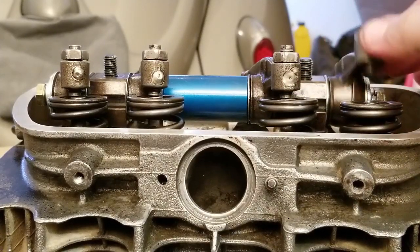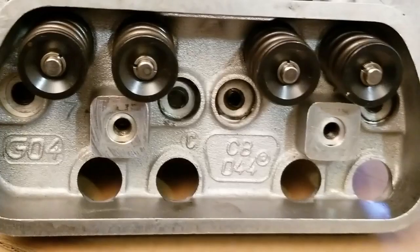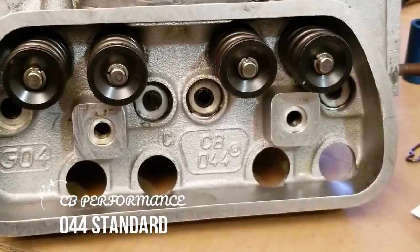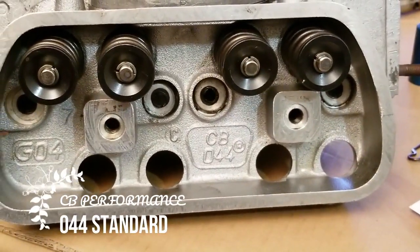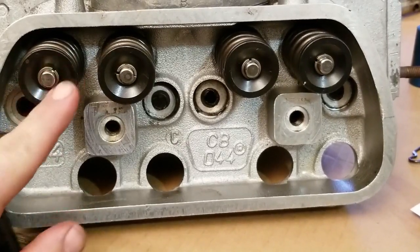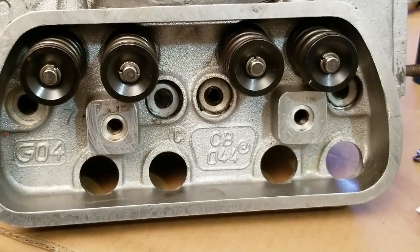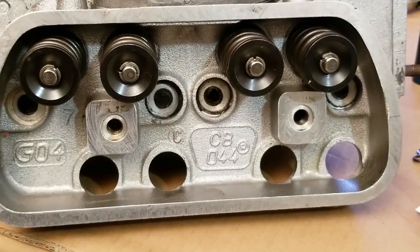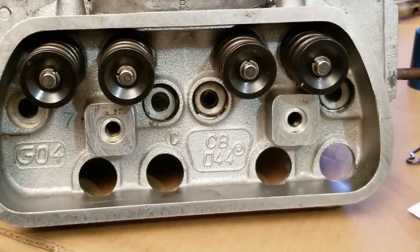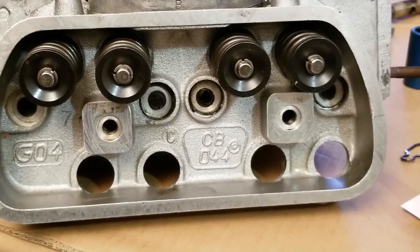Also the rocker arms themselves. Take a look at the larger head. And you can see that once you get to something more of this setup, the need for a solid rocker shaft is a necessity, because of the pressure on these springs, and the amount of RPMs and force you'd be pushing out of a CB head would definitely kill one of those rocker arm assemblies and wavy washers everywhere.